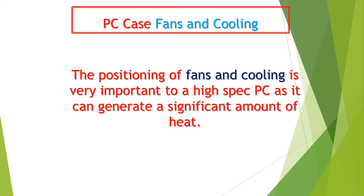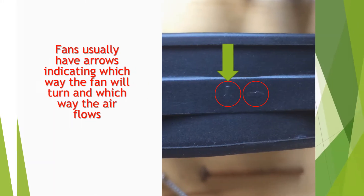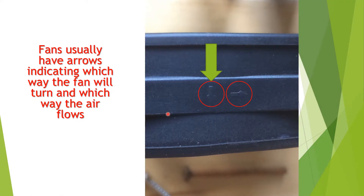One of the important things you need to do when building a PC is prepare yourself for sorting out the cooling. The case usually has fan positions at the front and back, so you need to populate those and make sure your PC is being cooled sufficiently. When you look at a fan, it should have a couple of arrows on one side. One shows the direction the blades rotate, and the other shows the direction of the airflow — in this case, air is being sucked in from that direction.